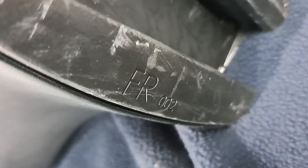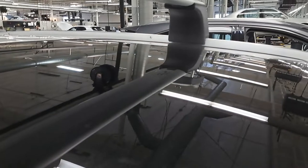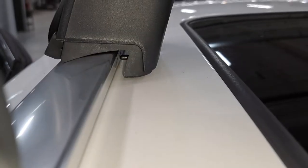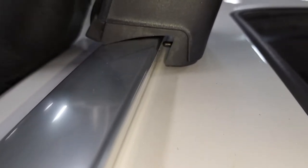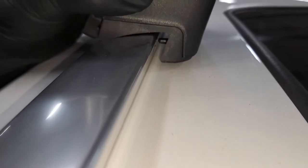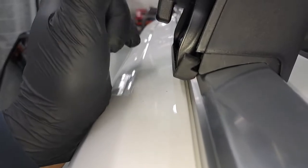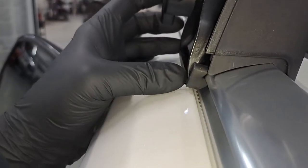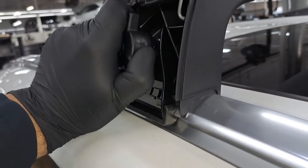I've placed the crossmember on top of the roof. Those are the guide pins that are going to go inside the holes we left exposed when we put on the clear sticker. I've chosen to use the front two holes — you could use the rear two if you want. Don't pay a shop to install these crossbars when you can do it yourself — it's easier than building Ikea furniture. Just align the guide pins to the holes, pull it through, loosen up your rear adjustment, and it wraps around the bar on the body. Tighten it until it clicks.